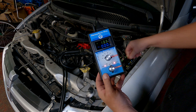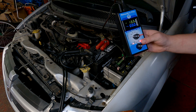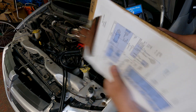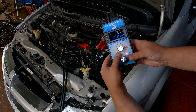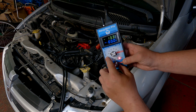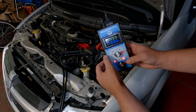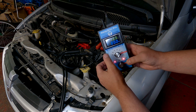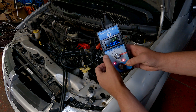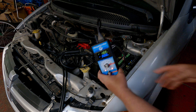So now you can see we have a fault on 87 and 87A. From our wiring diagram, we're going to have a fault on 87A because it doesn't go anywhere — this is a four-pin relay, so 87A does not apply. We can ignore that side of the tool for now. But we also have a fault on 87, and we don't have control. The control lights are off and the fault light's on. If we had control, one of these two lights will light up — whichever one has positive polarity, either 85 or 86 — as long as you have a feed to the control side and a good ground.